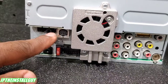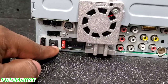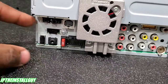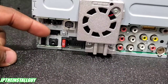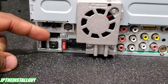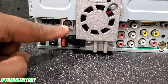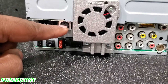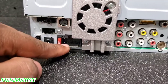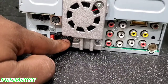This right here is your USB, and here's your auxiliary — you can run both of those from the back at the same time. This one right here is the iDataLink plug, so this is Maestro-ready. If you have the Maestro RR and want to gain some extra features, this is where you plug that in. This radio is also SiriusXM-ready, so if you have the V300 you'll be able to plug that in. And over there is where your main harness goes for your power supply.